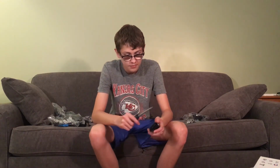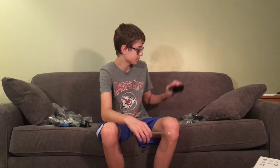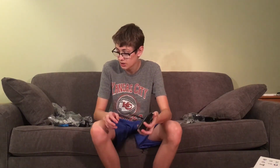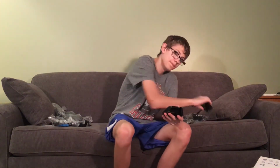And so we need to get to these to mount it to the monitor stand, right? So how you take these things off is, 1, go to that video that is linked in the description and watch that, and 2, shove your screwdriver up in this hole and unscrew the 2 screws that are in there, and it'll just pop off. You do not want to lose the two screws in there, and you want to keep this too in case you ever want to undo this mod. That's what's nice about this mod, is you can undo it and still have a nice monitor. So I did that to all 3 of them.